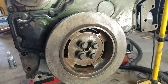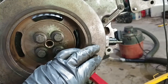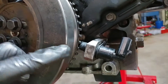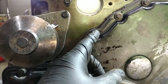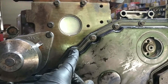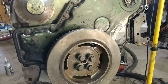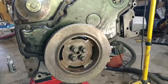And we will call that done for the vibration dampener or harmonic balancer. One thing to note — you can see that stamped line in there, that is the TDC mark. Unlike the 12-valves and earlier ones, these actually have a TDC mark. TDC would be pointing roughly toward the base of the fan hub, around that bolt right there. We'll go over that later when we're setting valve lash. There it is — your harmonic balancer, and we'll see you on the next piece.